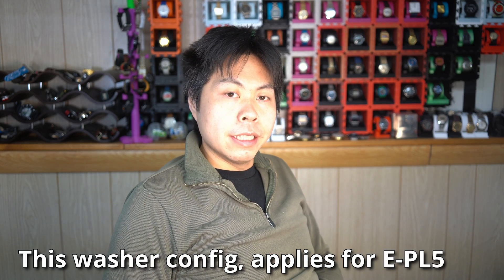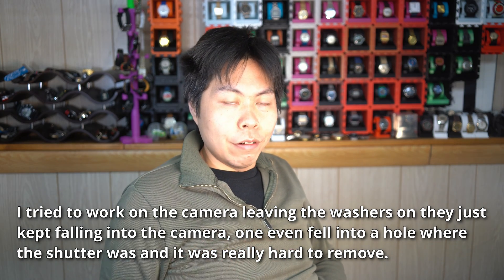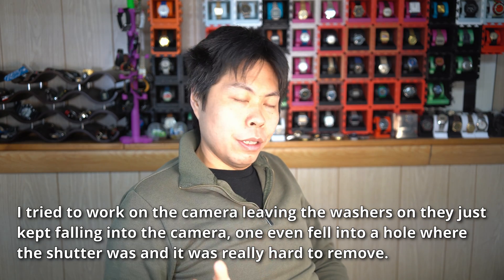Another thing to keep in mind: when you inevitably do drop one of these washers, just carefully grab the sensor, press it against the body, and tilt the camera body up to down — don't drop the sensor of course, since there's still at least one ribbon cable connected and it'll tear. You are going to need to take the washers out and set them aside for later when you reinstall. The third tip is that when you reinstall, the washers are just there to space the sensor and it's really annoying. If you're not great at hand-eye coordination, the washers are going to shift and fall. So just grab a tiny dab of crazy glue and glue the little washers into place so that when you screw things back in, you won't drop them. That's honestly the easiest way to go.